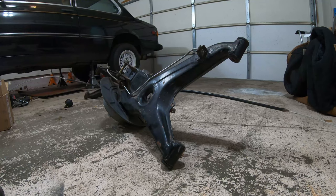European model trailing arms, I believe off of a 323i. In the United States, we only ever got the 320i, which was the four cylinder M10, and they came with drum brakes on the rear. There's a couple different ways that you can do this swap, but really the easiest way to swap disc brakes onto the rear is to just swap trailing arms from a 323.